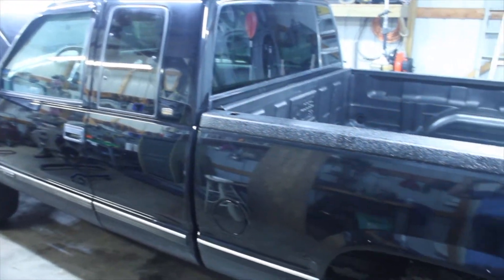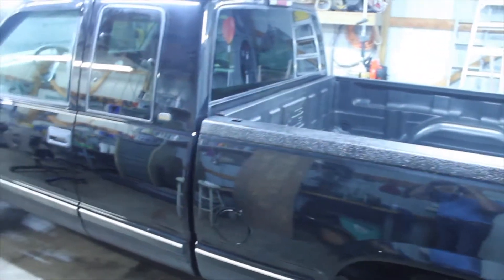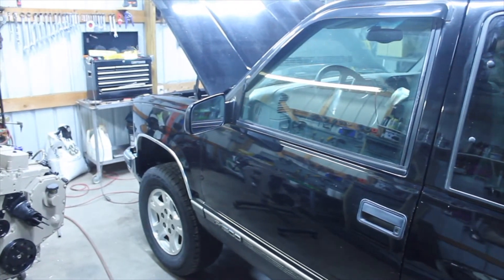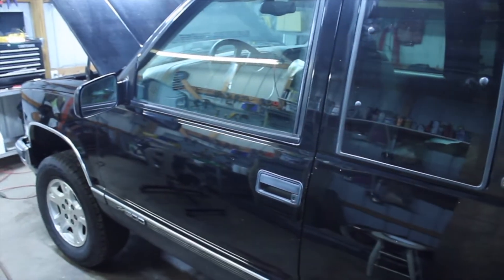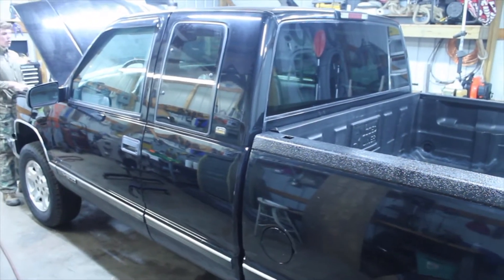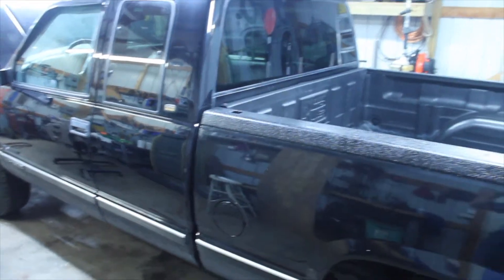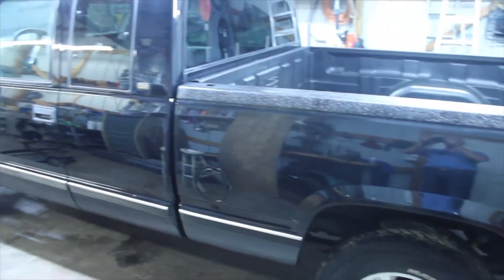This truck also has an automatic transmission — it's a 4L60E. I know there are pros and cons with this transmission and I know the best thing to do is step up to the 4L80E, but we're gonna try to run this 4L60E with the Cummins and see how well it does. We're gonna get a quick shift controller and see how long we can make it work. If it doesn't hold up, we'll definitely go to the 4L80E and make some driveline modifications — shorten the rear driveshaft, extend the front driveshaft, and redo the mount on the 4L80E to fit the existing 4L60E transmission mount.